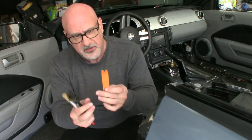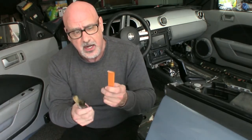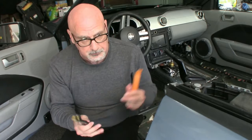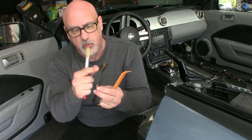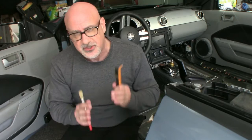I'm just going to scrape away using the plastic — that'll prevent doing any additional damage to the floor pan. Then I've got a wire brush made out of brass and a regular brush just to get the edges. Then I'll vacuum things out, and then I will be laying the sound deadening material. It's actually sitting out in the sun right now, which is probably why I'm really bright.